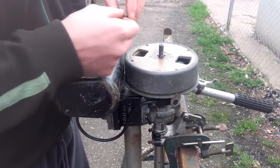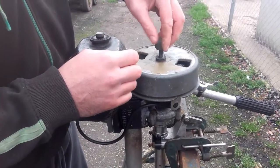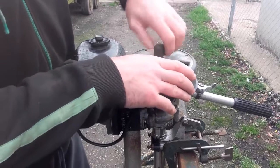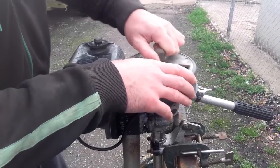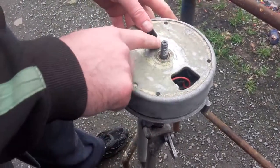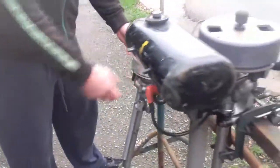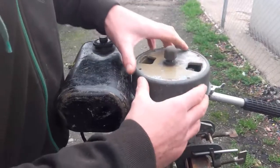What I like to do is put on a couple of rubber washers, because sometimes the impact will have to be quite hard to get these to release. I have another one here — you can see from this example that there's one with a crack in the top of the flywheel. That may have fallen on its head at some stage, but that's the damage that can occur if you don't put a washer or have some sort of protection, because it will take quite a bang to get these to release.